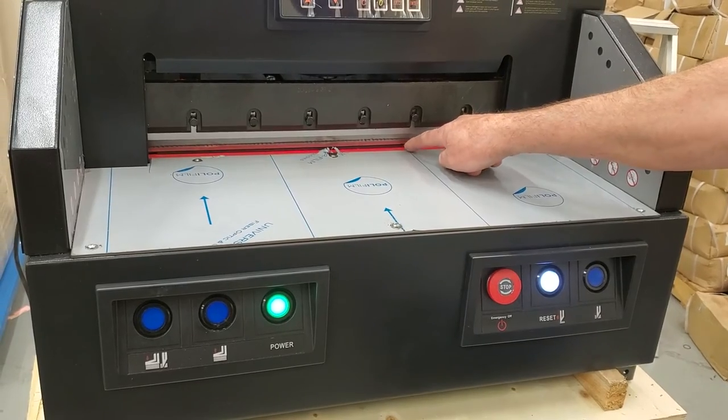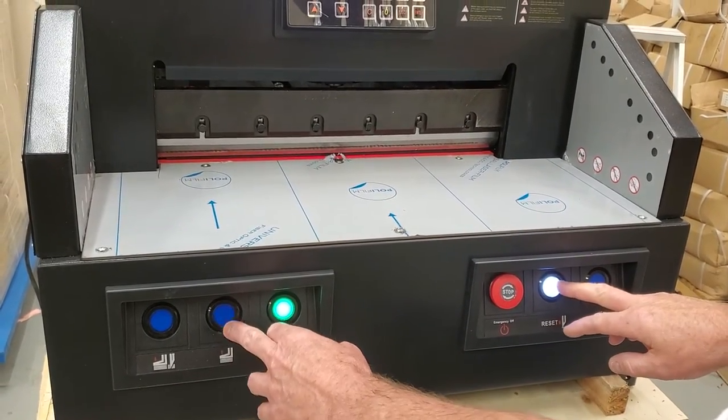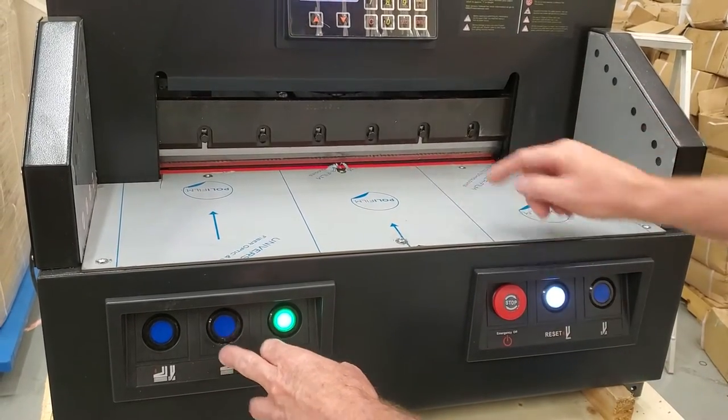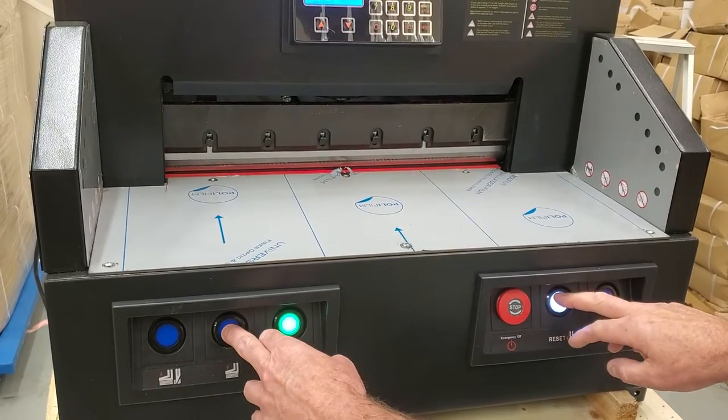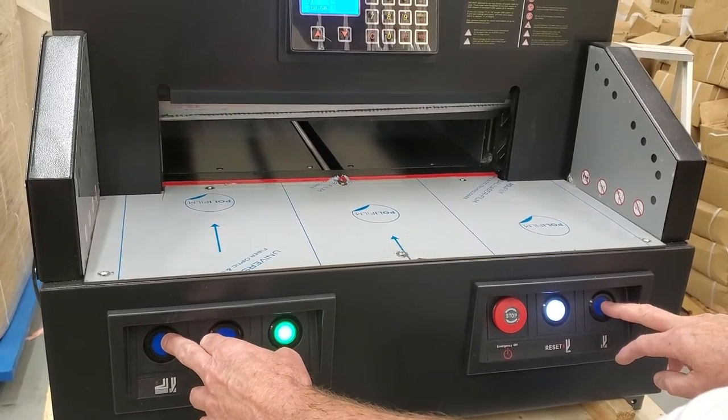See, that's a little too high — you could potentially cut yourself there while you're cleaning it. If you're careful that's fine, but you've got to always remember this blade is super sharp. Even if it's an older blade it's like a giant razor blade. I'd like to get it down a little lower — it's still up about a quarter of an inch — so I'm going to reverse it and try it again to see if I can get it all the way to the red pad.